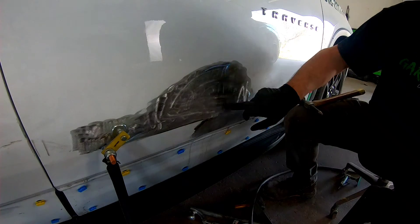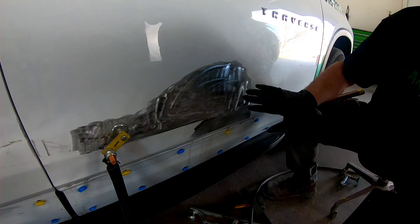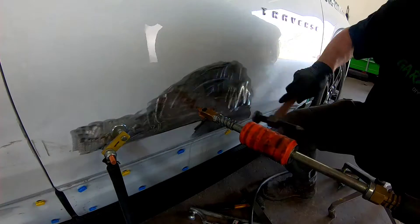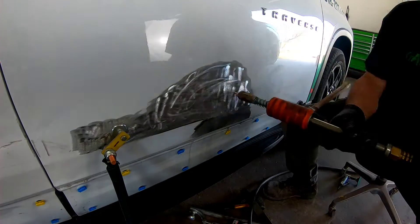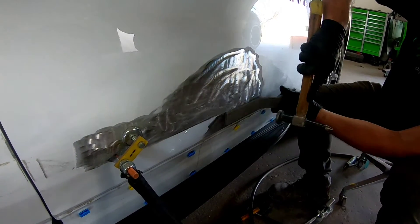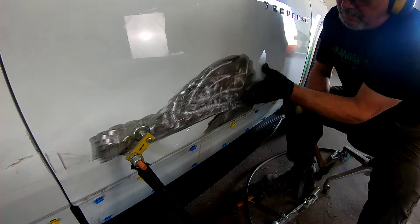We've got a low area right here. What we're going to do is move along and pull this out, and as we do a pull, we're going to tap around it as close as possible. That'll lift that metal out just a little bit — we're not going to hit it hard, but we're knocking down any crowns around it, then we'll move on down because from here to here there's a low area. I'm going to use a tool called a shrinking slapper to lay on this metal and then use my hammer to deliver a blow. That's going to spread the blow of the hammer across a wide range of wave in this metal and help flatten it out.